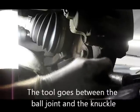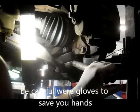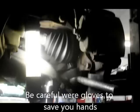Now, when you get this up to a certain point, you can't go any further because the nut won't come off. So what you've got to do is take a fork and separate it right in here. I'm going to take a good swing with this to give you an idea of sometimes how tight these things are. Then you can hear the pitch change and it pops right out. Then you just push down on it, screw the nut all the way off, and take it out. We're done with the fork for now.